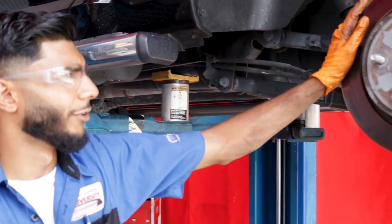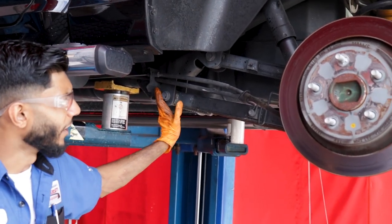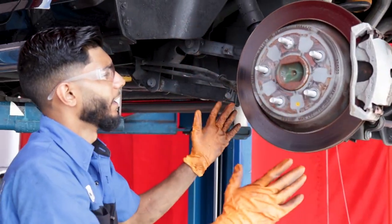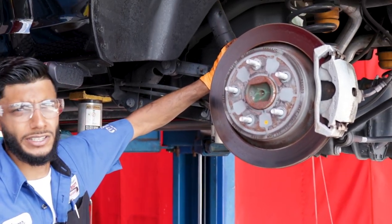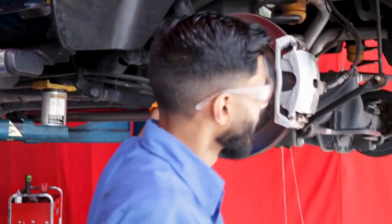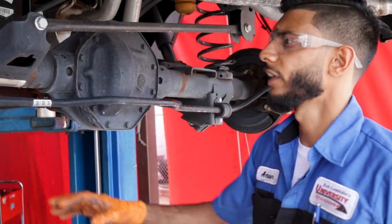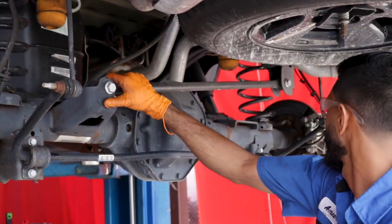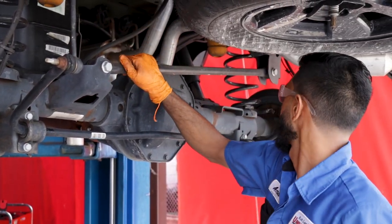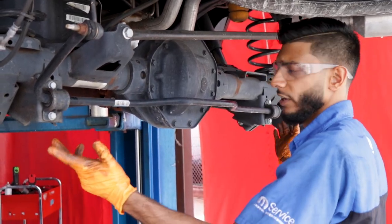We're going to begin the rear disassembly on the 2015 Ram. The rear end is pretty simple — you're basically going to loosen the lower control arms, lower the rear end, and loosen the shock. We're going to have to remove the fender liner just to access the bolt up top for the rear shock. Then we're going to put our pole jacks in, support the rear end, and lower it down. We'll disconnect our sway bar links from the top, disconnect our track bar, and that's where we're going to put our track bar extension. That big bracket will basically level this out because the rear end is going to be lower than what it is right now.